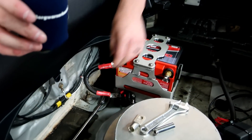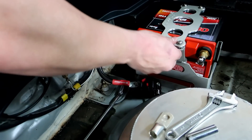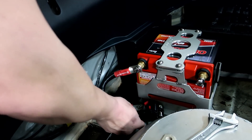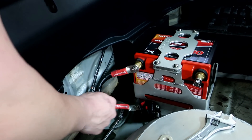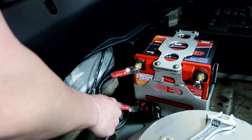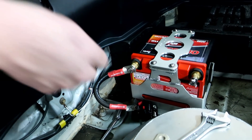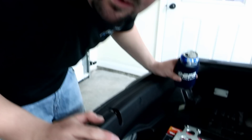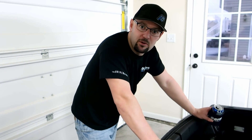That's all done. We've got our power wire here to our 250 amp switch. I've used one of the factory bolts that come with this little clamp because I didn't want to drill in the body anymore. I used this to ground it out and ran it as short as possible from here down to here. And you're probably wondering, Ryan, why are you using black for power wires — for me it doesn't matter, you're never going to see it. These little red indicators are good enough for me, plus it says plus and minus on the battery. The last thing we've got to do is run one from here all the way up to the front, which is going to be time-consuming — that's not going to happen today. I'm going to try and get that done tomorrow.